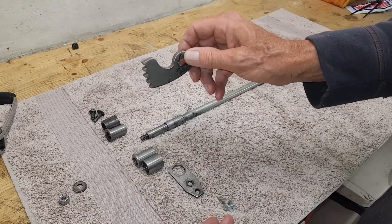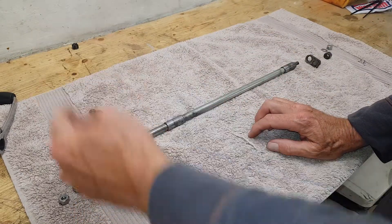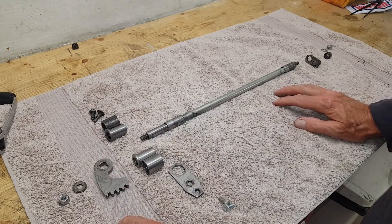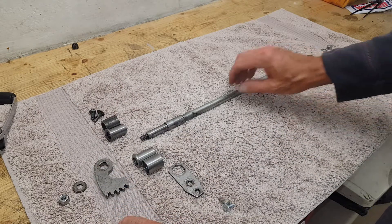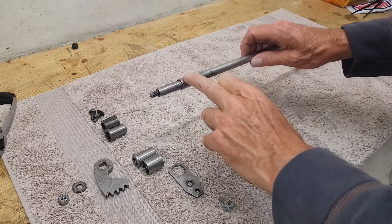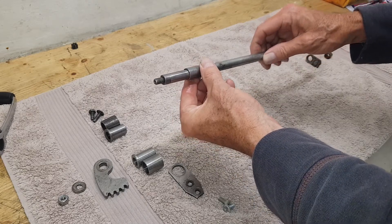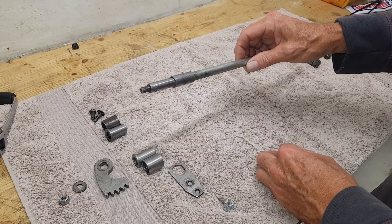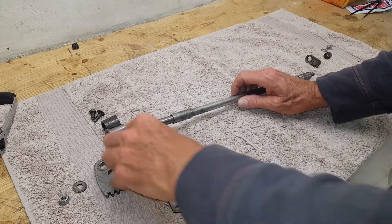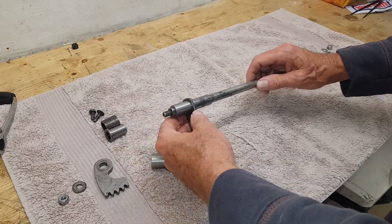At the other end is what we call the foot — you can see pretty clearly why it's called that. There's another foot which meshes onto it and connects to the actual gear lever. This comes out of the primary chain case through the needle roller bearing and a little oil seal.